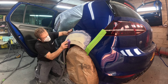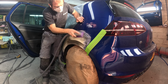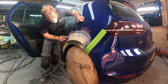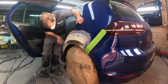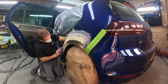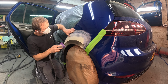So yeah, the first skim of that was Rage Gold filler, and I thought I got the repair. It felt good in one skim, so I went for refining the scratches. That gold I normally knock down with 80 grit first to take the bulk off. I sand off the top surface with a DA sometimes, and then just refine those scratches into 180